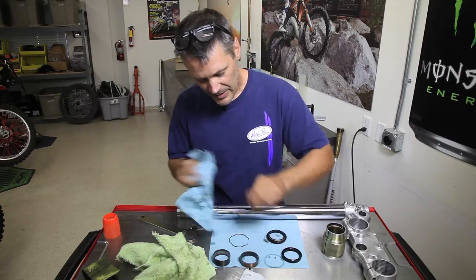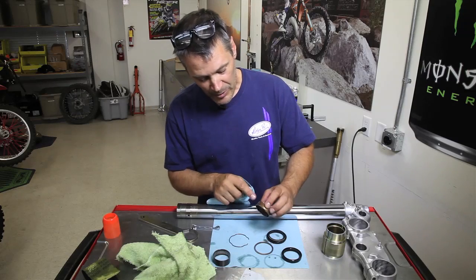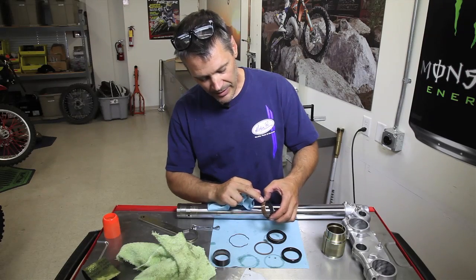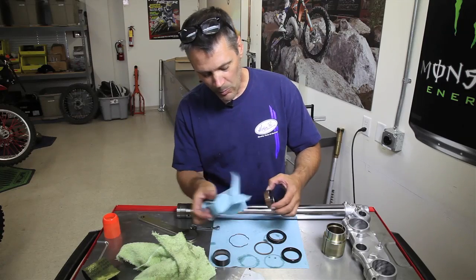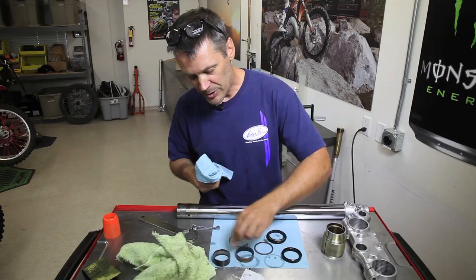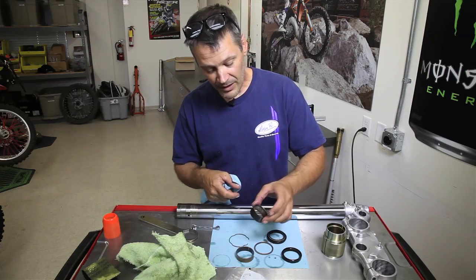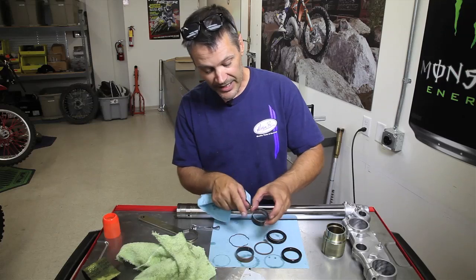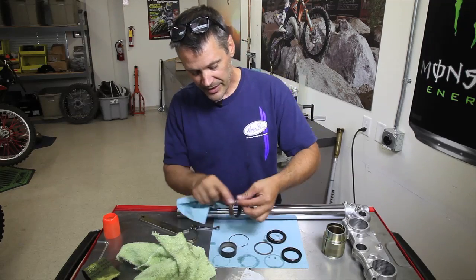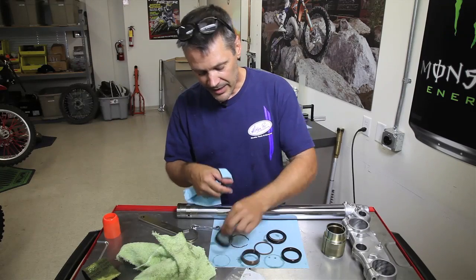And then I'm just going to look at these bushings, make sure there's no imperfections. You want it to be this copper colored the whole way through. When you see it worn out, it'll be silver, that copper color will be worn right out. This bike doesn't have very many hours, so we can use those bushings again. Same thing with this other bushing. You want to check the inside here and just make sure the whole thing's not discolored. We'll still use these. Just make sure these aren't bad on the ends. Okay.